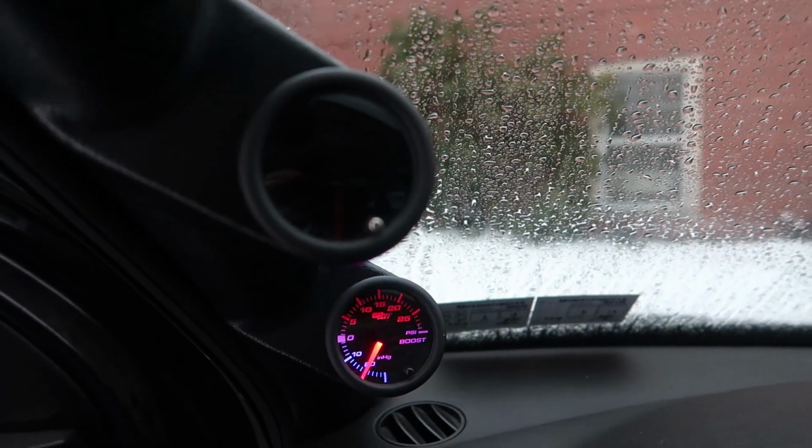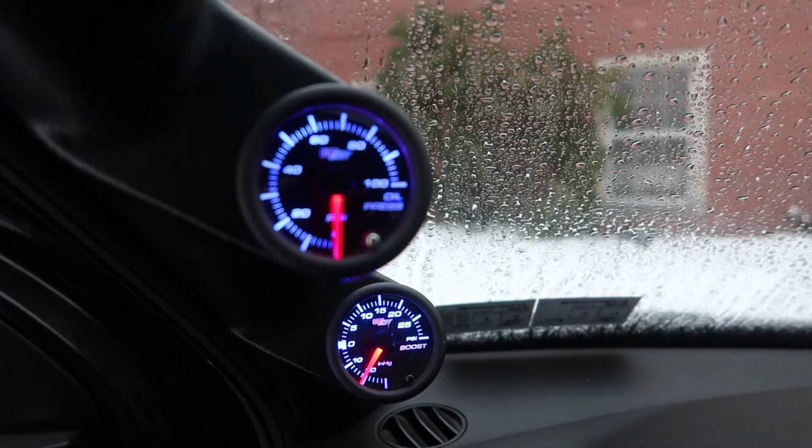You'll notice the gauge is actually below. It looks like negative, but it's not, it's vacuum. If it has a vacuum leak or it's not pulling any vacuum, the gauge won't go down to 20, or it'll be at like 15, or it'll be at 0, or it's not building any pressure, but it's not pulling any pressure, making vacuum because there's something wrong.